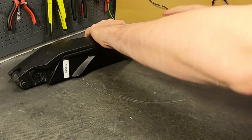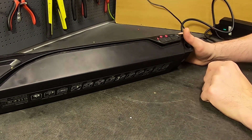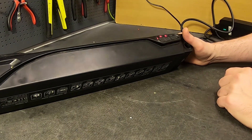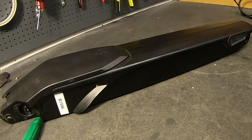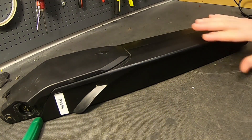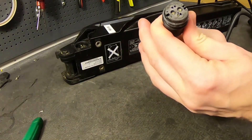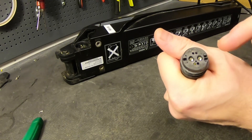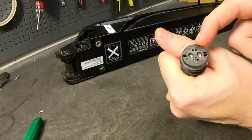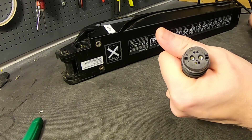I don't know if this is an on/off switch or just for power - it's flashing red. I'm going to see if I can find out what that means before I open it up. From different forums, three red lights means the battery management controller says imbalanced cells. That is actually something we can fix if it's imbalanced cells. Looking at the outside, this Rosenberger connector has two pins to transfer power, two pins to make power go on/off, and two pins for data transfer.